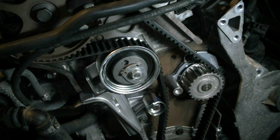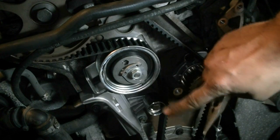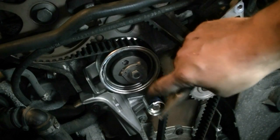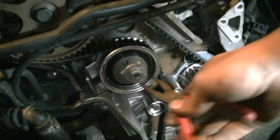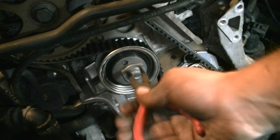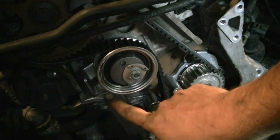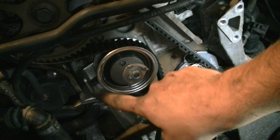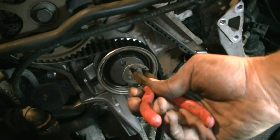Here comes the tricky part. I think I forgot to mention this before — I took off this roller, but you need to get the approximate location of where this tab is going to be pointed at before you take it off. Just make a mental note and put it roughly around the same position. You can adjust it — it needs a special tool, but you can do it with just needle nose pliers — because if you leave it here and then you take this pin out, the piston is going to travel way too high. There's a certain space we need to maintain between the piston.